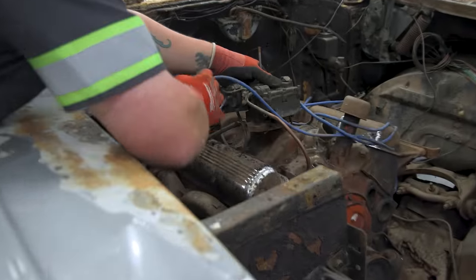Now I'm going to be installing the upper and lower control arms. It's going to be the second part going on - one of the uppers or lower control arms. After that it doesn't really matter because it's starting to go back together now. I can't tighten those up because there are shims on that fender - you have to put shims back in it so it's still somewhat aligned when it goes to the alignment shop. I retrieved three shims - marked them LB for left back, RF right front, RB right back. Got the left one installed, just putting the nuts on the bolts and then putting the shim in the left back spot.